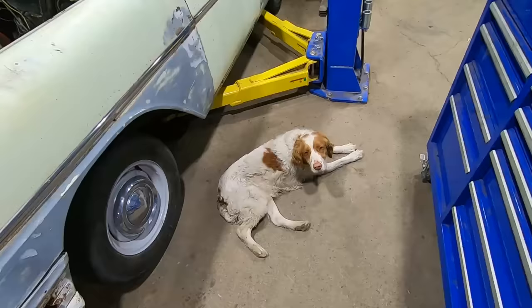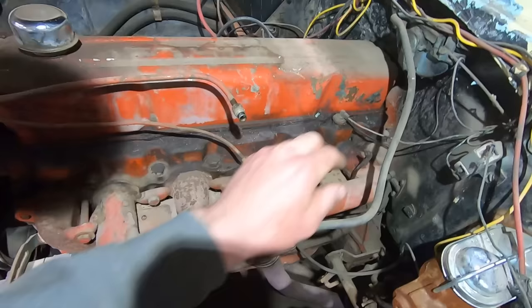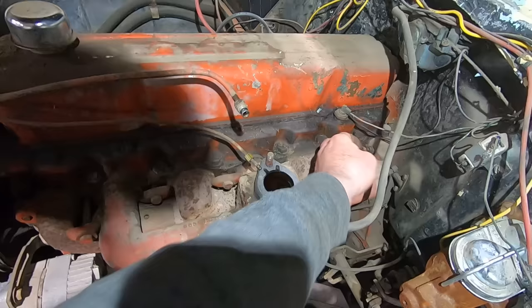Right, Duff? Yeah. The beauty of these things is there's a vacuum line, a fuel line, two 5/16 fine thread bolts, and a throttle linkage that you can literally hook up by hand, and that's about it. They're about as easy a swap of carburetor as you'll ever find. Old Rochester one barrel.